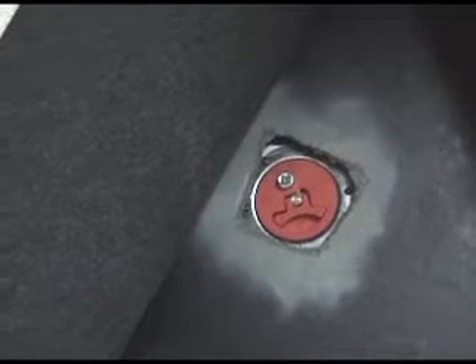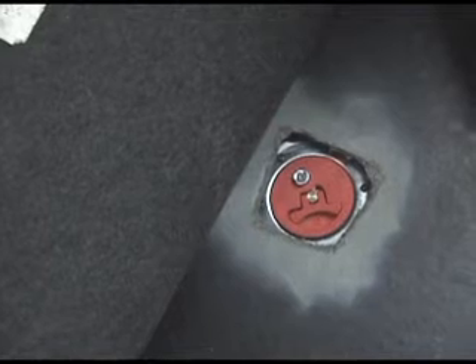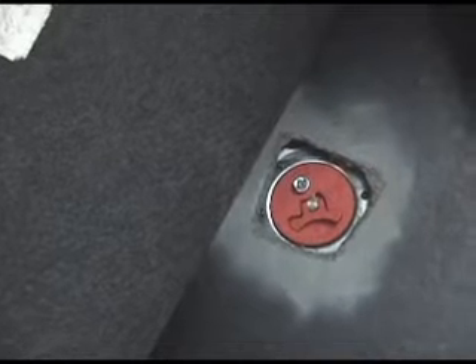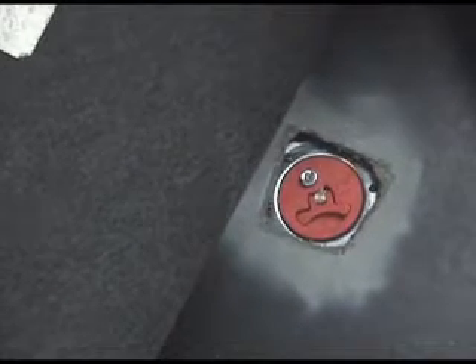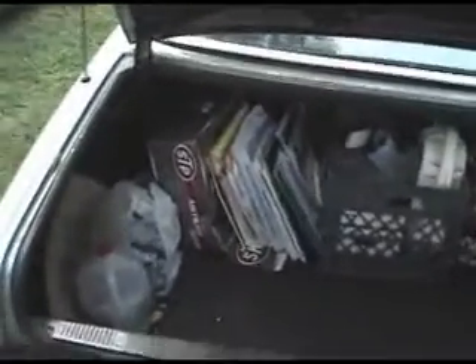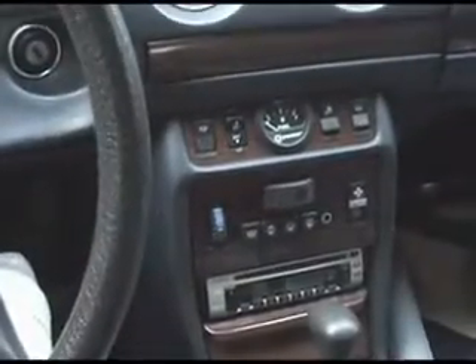Here's Casey's trunk. Her grease tank is here — that's where she puts her grease in. Inside of there, there's a heat exchanger that takes water from the engine and runs through the heat exchanger, which heats the grease in the tank. The grease fuel line is actually inside the water hose that runs back to the engine, and goes through the valves depending on whether you're running on diesel or grease, and runs through the valve into the injection pump and then into the pistons, where it works just like diesel fuel. All of that is controlled from right here.